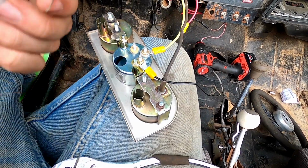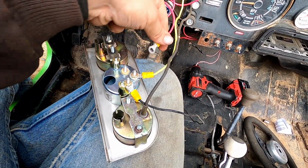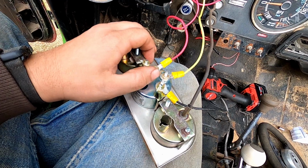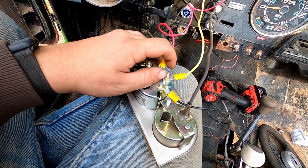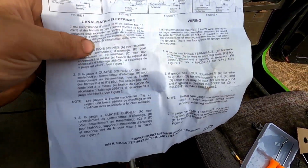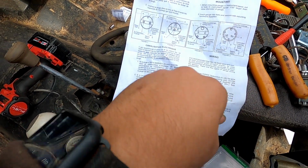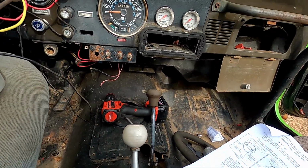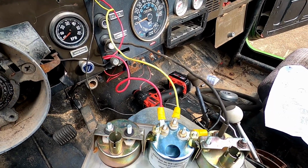All right, getting this gauge all wired up here. They've got these little isolator pieces, like washers pretty much. They go between your connector and the housing here on the ignition side and the sensor side. The ground side just goes straight to the body there. And I think I'd also misspoke earlier. For the sender, that's ground, and also ground if lighting is desired. Not ground for your light, but ground for the sender, and also your light if you do use it. So you still have to connect it either way. Let me just finish getting this wired up, and then we'll test it out.